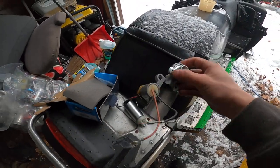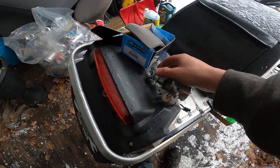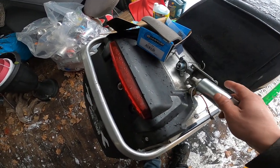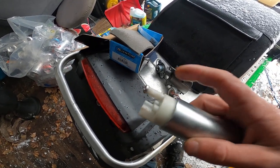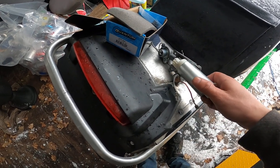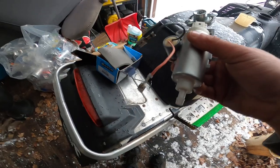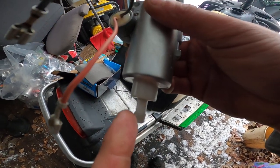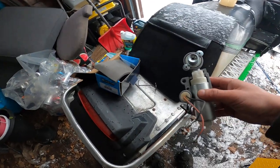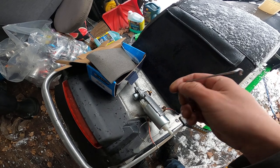I removed the old original pump. You get this unit out — the pump sits in here this way. A piece of rubber goes over this, but I'm just going to show you how it looks when you pull it out of the sled. Your smart valves are down here. The first thing you've got to do is take this lock ring off.